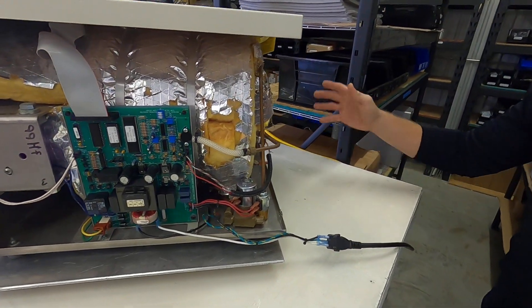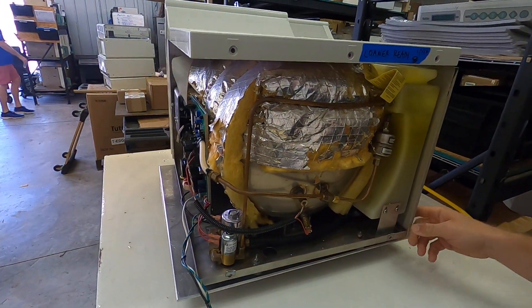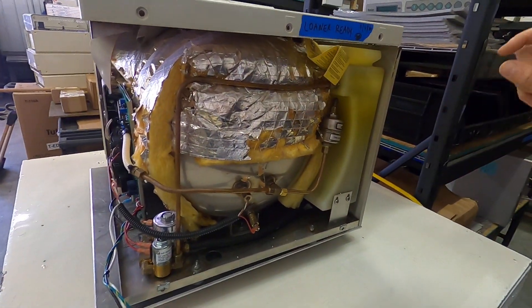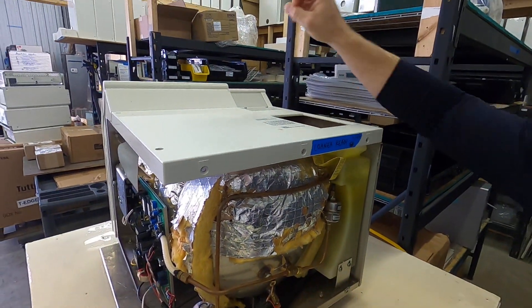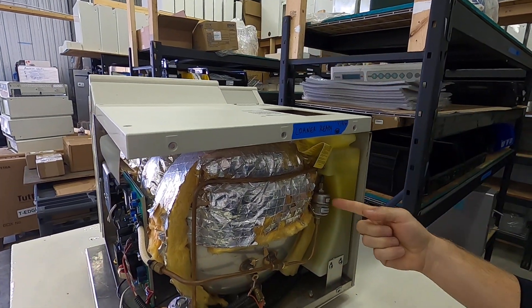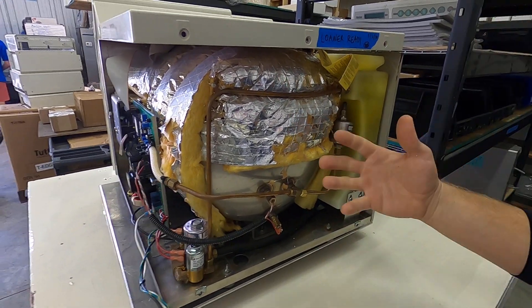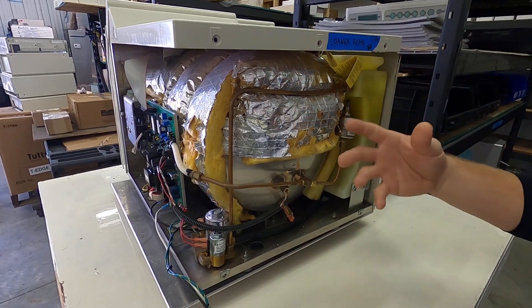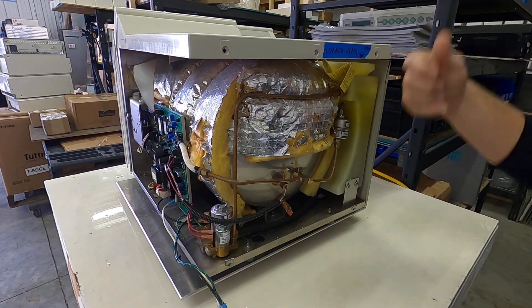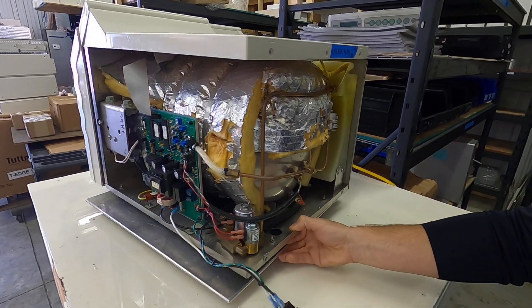And finally, it could be a bellows. Say you start the cycle, it starts heating up and you see steam coming out, but you have no door gasket leaks — basically your bellows could be stuck open. At that point, as the heater element is heating and boiling all the water, it steams right out the back of the unit, never builds pressure, and the overheat protector trips and fails.